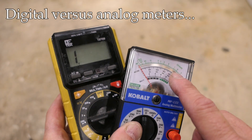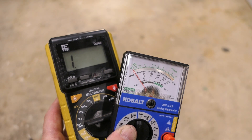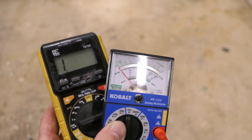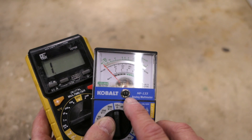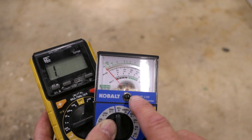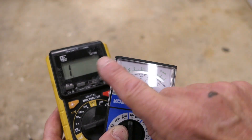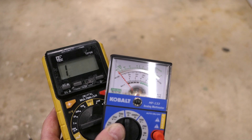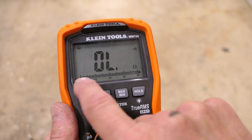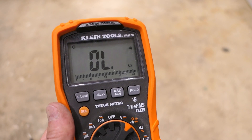Is there an advantage of an analog meter over a digital meter? Generally speaking, the digital meter is easier to use - a lot of them are auto-ranging and simpler to read quickly. However, there are cases where an analog meter is superior. I did a video on diagnosing a throttle position sensor, and in that video you can see that an analog meter is a better choice because you can actually see the needle move, whereas numbers bouncing back and forth are harder to interpret. Some digital meters try to emulate an analog meter with a small moving scale, but I still think an analog meter is superior in some situations.